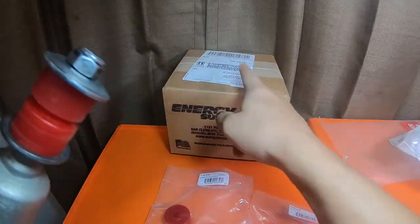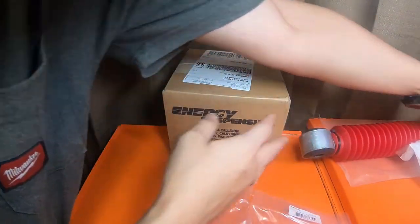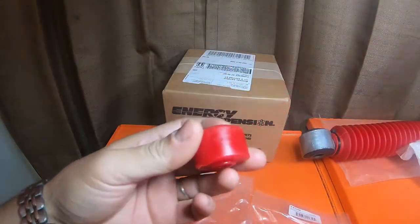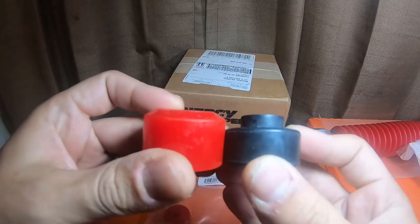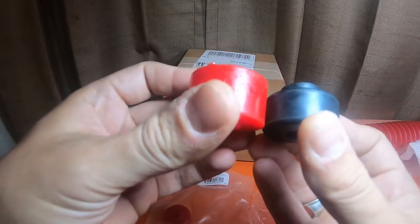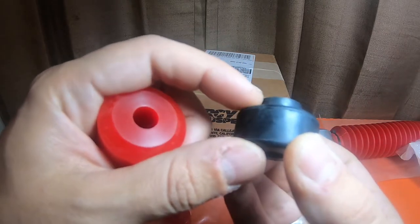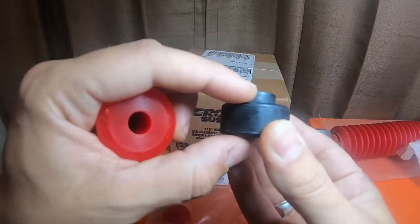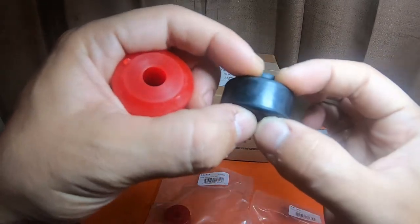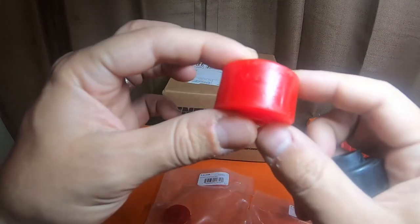I did pick up these to fix that issue. So the measurement of this is correct, but it's the height of this nipple. So it, in a sense, doesn't work, because this actually goes into the frame. This quarter inch thick nipple goes up into the frame and it's flush. So the thickness actually needs to be this section right here, which is 5/8. This is 7/8.